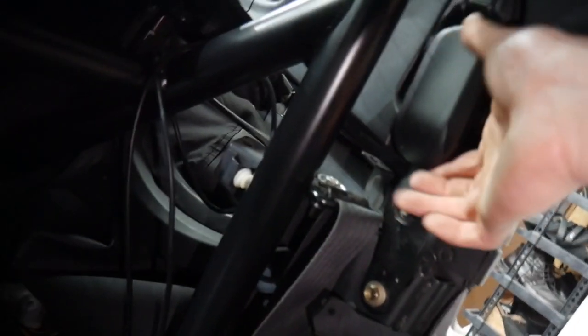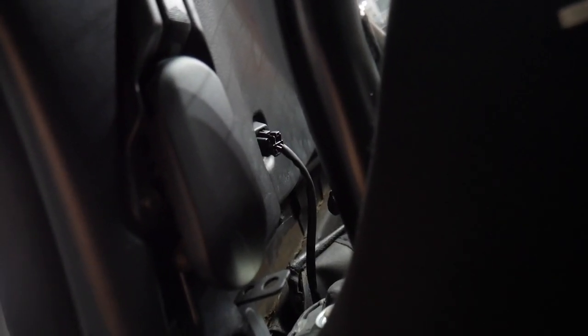So I did get those side latches installed — you can have it on both sides. And then also on the OEM one, the defroster works. On that clip where the defroster wire is, you unplug it and then you wire in the new longer one and put that into the hardtop. So now the defroster will work. For the other side of the defroster wire, you plug it in right on the passenger side, right behind the side latch — you'll see the plug. You just plug it in. So this routes all the way up.